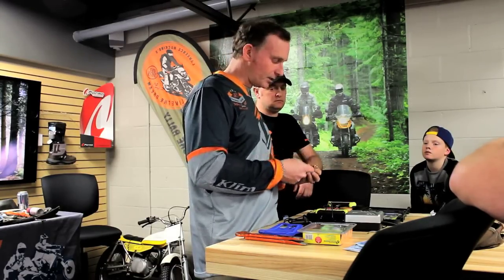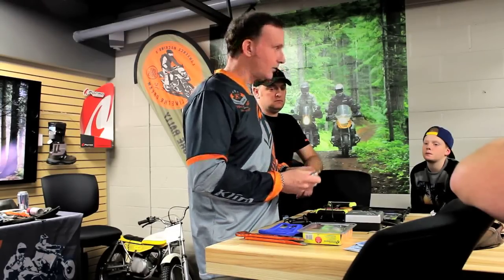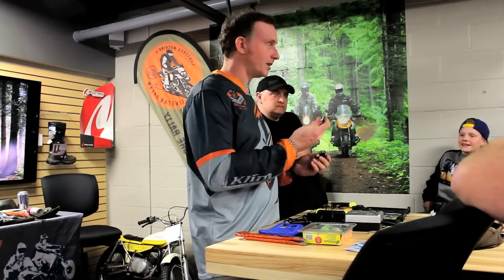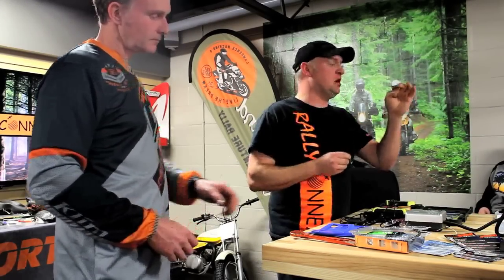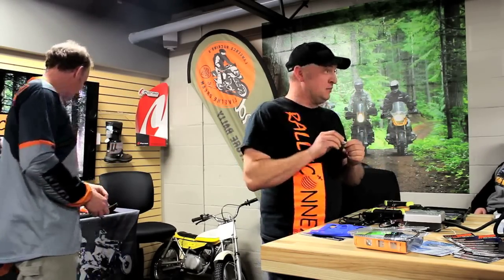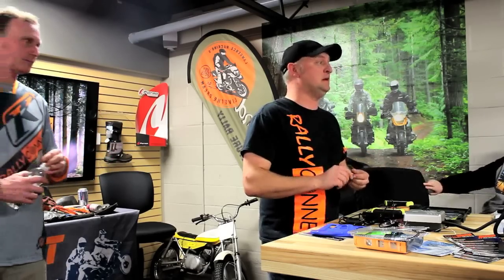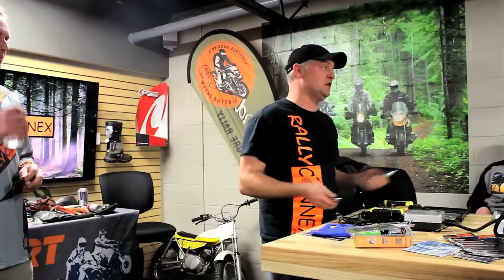This has got to be wound down tight to tighten against the rubber seal in there. Make sure that was backed off all the way before you wind this in. Otherwise you puncture it and you waste it up past the threads. If you get any dirt at all in there, even just the smallest little pebble, you can barely see it, kind of like the same dirt that gets in your carburetor and sticks your pilot jet and things don't run, it won't seal. So like Kevin was saying, you're going to thread it on, and if you're not ready to put on your tire immediately, you could have it on all the way, puncture the cartridge, and it's just going to go psh, and you lost all of your air.